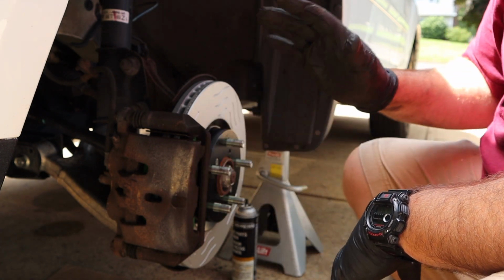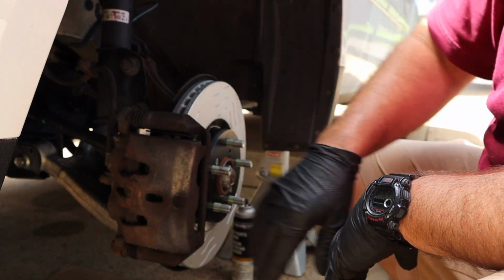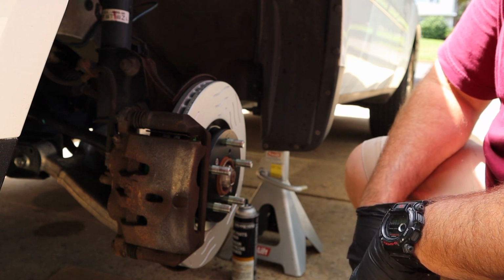Make sure you carefully push the pedal down a couple of times to take up the slack in the caliper pistons, push them out again. We'll see. Just looking for better braking performance. Hopefully I'll have it with this. I'll keep you posted. Thanks for watching.